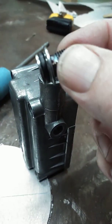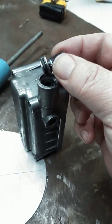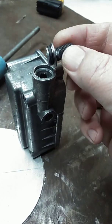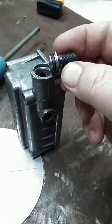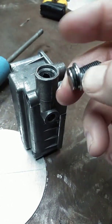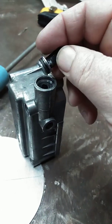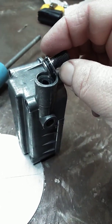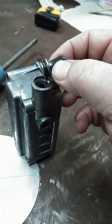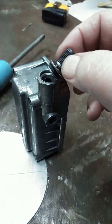It's actually a machined plug with an o-ring — can you see that? Of course, when you rebuild your carburetor you use carburetor cleaner and other cleaners, and maybe that plus the crappy gas nowadays with the alcohol and additives — who knows what's in there — the o-ring kind of went away.